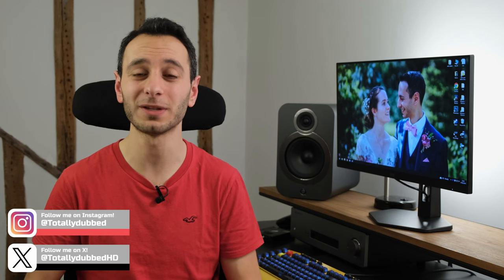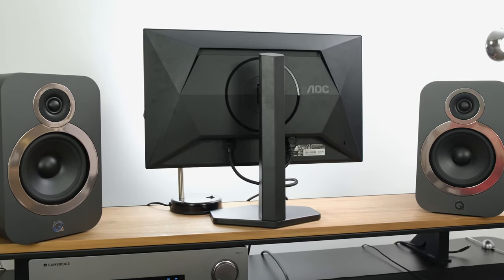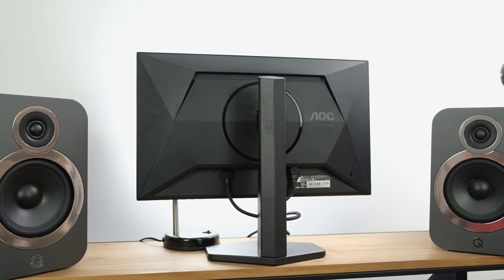So with all that in mind, it brings me on to my verdict. Truthfully, I absolutely love the AOC 24G4X. It has got low input lag, a good response time specifically for a 180Hz panel, MBR which can be used simultaneously with adaptive sync technologies, a colour-accurate IPS panel at least in the sRGB colour space, a comprehensively laid out OSD, and great ergonomics. Couple all of this at a budget price and it makes this monitor an easy recommendation — as such, it gets my Best Buy award. That said, do consider its predecessors running at 165 and 144Hz, which are still fantastic budget gaming monitors and may be found cheaper. And if high refresh rate is your top priority, you might want to look at 240Hz IPS or VA panels, which aren't all that more expensive, some of which I've reviewed and will be linked in the description.